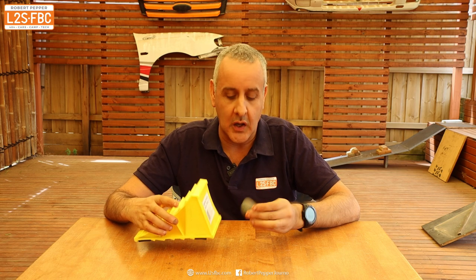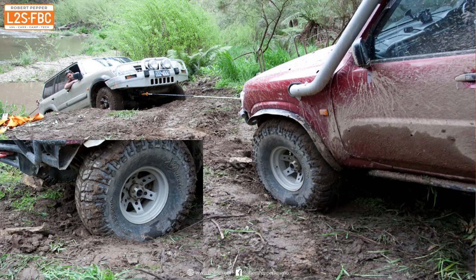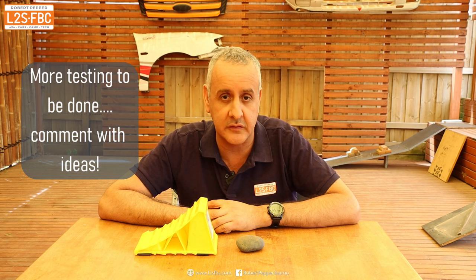In summary then: chocks like these can be effective if the wheel is just going to freely roll, but if the wheel is going to be locked then they're not very effective. Really the most effective way to immobilize a vehicle is to actually dig a hole for the wheels - and if you do that, fill the hole in afterwards. There's a fair bit more testing to be done here, for example on all four wheels, more different types of chocks, tire pushes, etc., and I will do that at some point. If you have any questions or comments, please subscribe to the channel, leave them in the comment section, and let me know what you'd like to see. Thanks for watching!